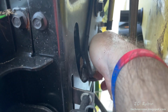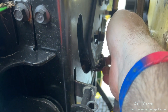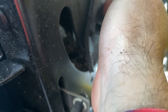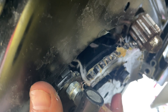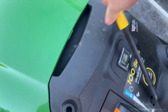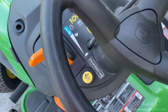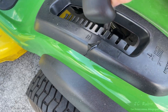This linkage by the steering isn't mentioned in the book, but I did see grease on it so I'm reapplying grease there, and also on that surface where the screw and washer are because it looks like it rubs and there's some mild rust. Once I finish this side I go around to the other side and do the exact same thing — the other side allows for a closer view. Getting grease in between those gears and on that metal plate where the washer rubs as the steering wheel turns. I work everything in by engaging the blades back and forth and turning the steering wheel both directions all the way. Then I raise the deck all the way up.